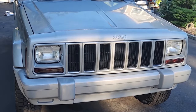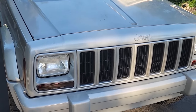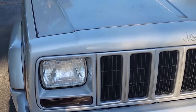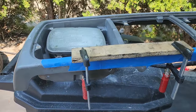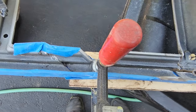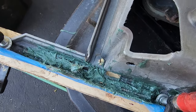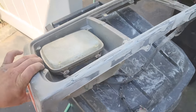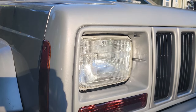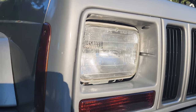Here we go — the nose of the Toad. Everything is nice and straight again on the front except for this fender. I don't have a new fender and didn't feel like doing body work, but I did do some body work to the header panel. This header panel was completely smashed up, so I made a little jig out of some tape and scrap wood, got it in line as best I could, then filled the whole channel with Bondo and mushed in some deck screws for support. When that was dry I flipped it over, slathered the whole front piece with regular Bondo, sanded it down, used a lot of filler primer, and painted it. I also painted and clear coated both headlight bezels — they came out really good. I got fresh new factory headlights too.